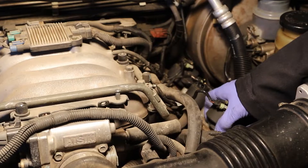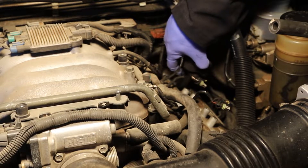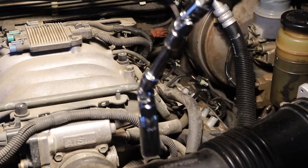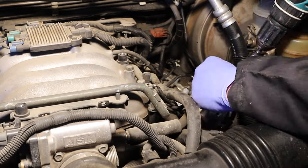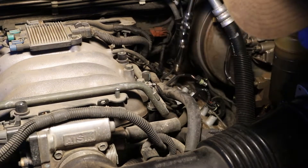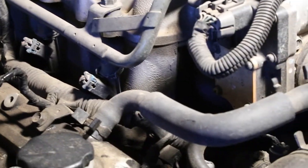This one's nice and clean but it ain't always the case. I know what you're thinking — that engine's dirty, why wouldn't you clean it up before you got started? I have a pressure washer but my problem is I've had bad luck with cars like this in the desert. Crusty connectors will let water in, especially if you try to power wash the engine bay. I've had to chase shorts down and it ain't worth it. We'll just clean it as we go.